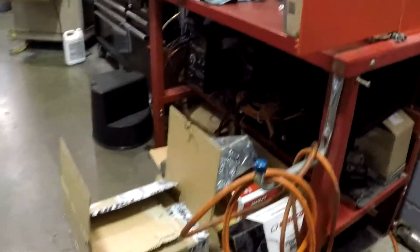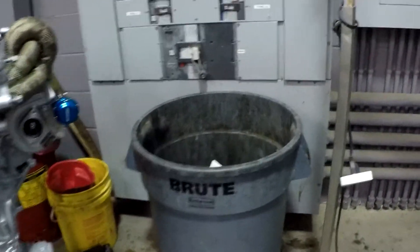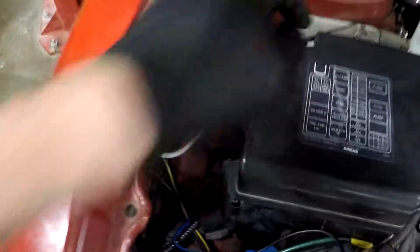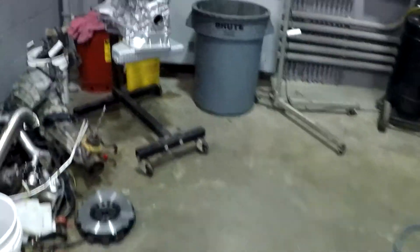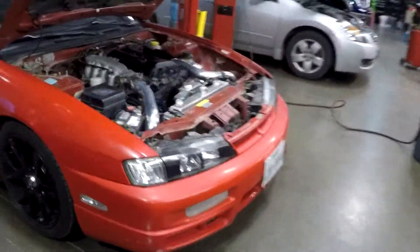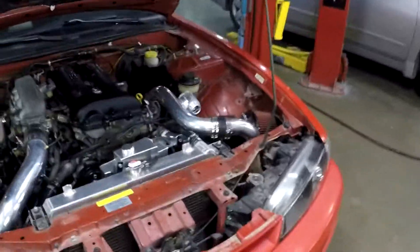You're already mocking up a turbo — fun stuff. I love that thing, I'll take a million pictures with it. Also, I didn't film it because we were working on it together, but I did wire in Greg's second fan up in here and added a relay for it. That's for his air conditioner so his AC works. At dead stop you need your fans on to circulate air and pull air away from the condenser while the AC is on.